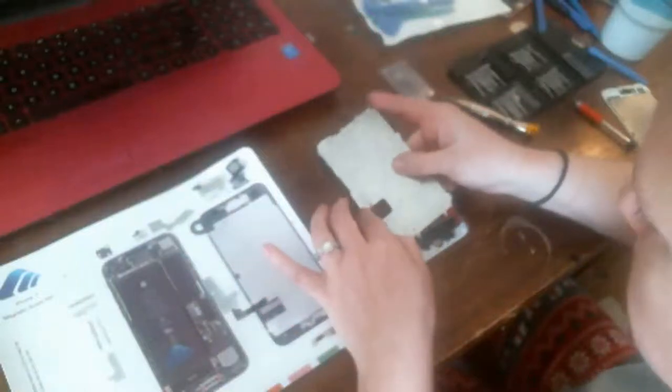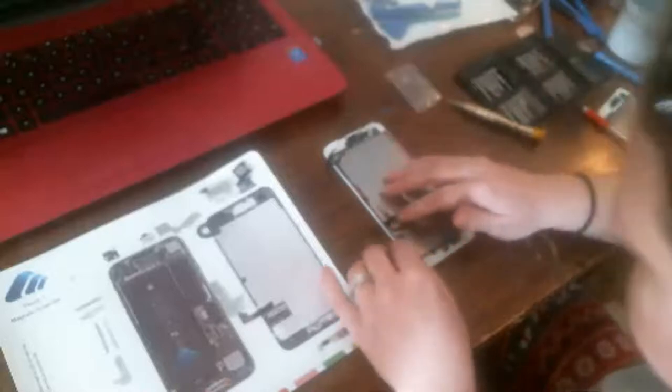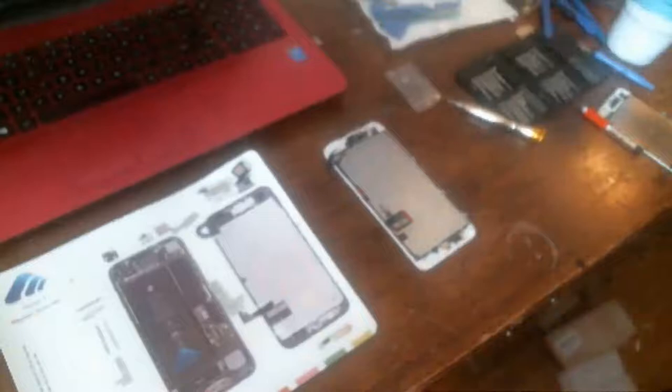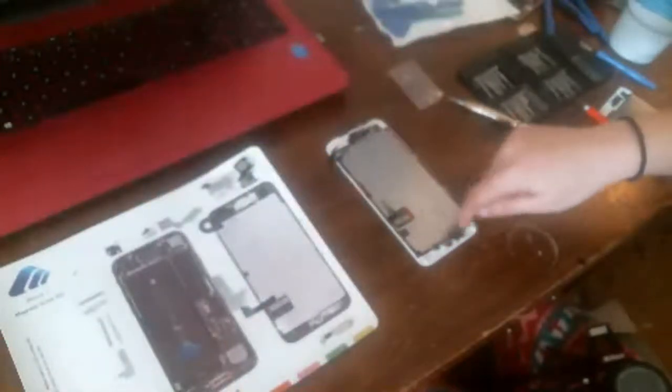So now we stick this back through here like this. Right? Is it like that? Or was it? No, it wasn't like that. It had to be. Okay, so now I'm going to get my camera again because I did take a picture this time. I know usually you take that plastic stuff off the back, but because these are the iPhone 7, if this cabling is not in the exact correct alignment underneath this metal housing, you get lines down the screen, bad backlight, short stuff out. So that's why I took a picture on my camera.